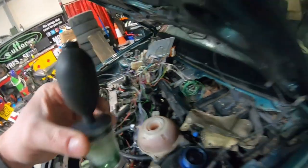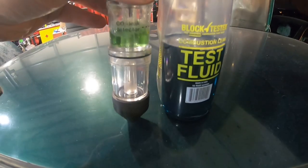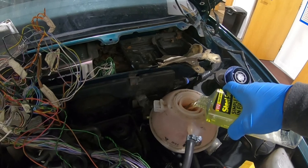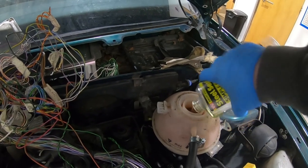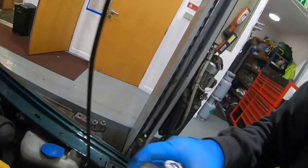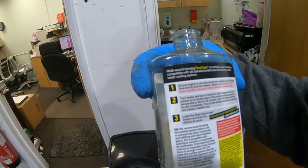It's now actually turning yellow — that is pretty conclusive. You can see before and after — massive difference in color. So yeah, head gasket gone. I'm wondering if my reservoir may be a bit full for putting Steel Seal in; I might suck some out.